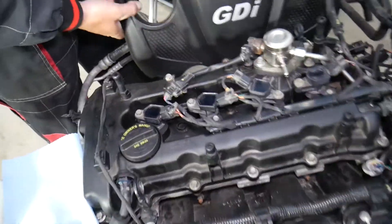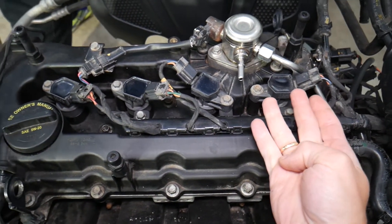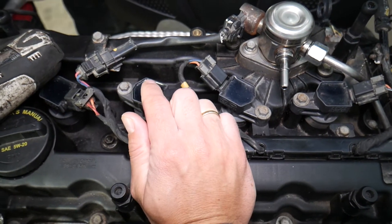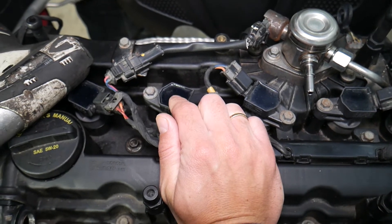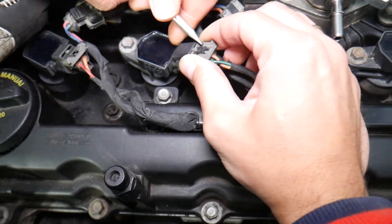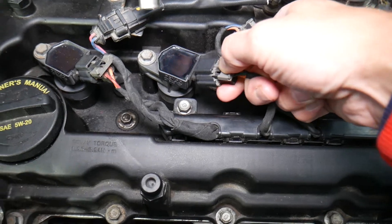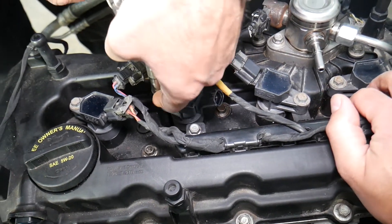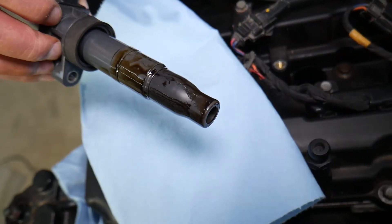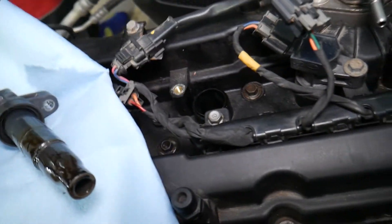What you need to do is remove your upper engine cover. Once you remove it, you'll find four ignition coils for this four-cylinder engine — cylinders one, two, three, and four, in order starting from the belt side, left to right. We're going to rebuild the engine and put in new spark plugs, so we removed the ignition coil. Push the safety clip in to release it, press down and pull it out, then use a 10-millimeter socket to remove the bolt and pull the ignition coil out.